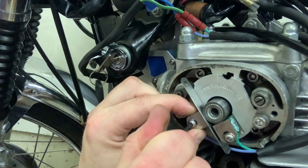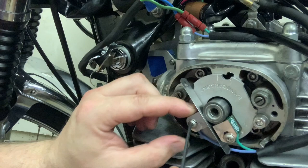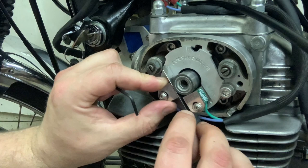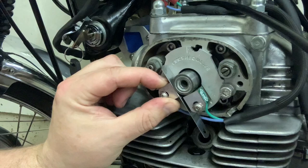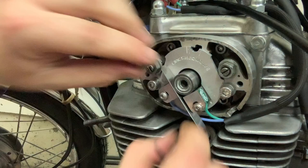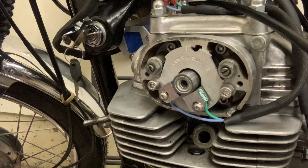Let me make sure I've got that snug on there — just like that, and that'll stay there. I forgot — I need to get some Loctite. With your blue Loctite back on your bolt, center your index mark on the sensor. Insert your 0.3 feeler gauge in between the sensor and the advance unit, and tighten this bad boy home — just tighten it all the way up. Hopefully we will never have to move that again. You're going to need that 0.3, so don't lose it.